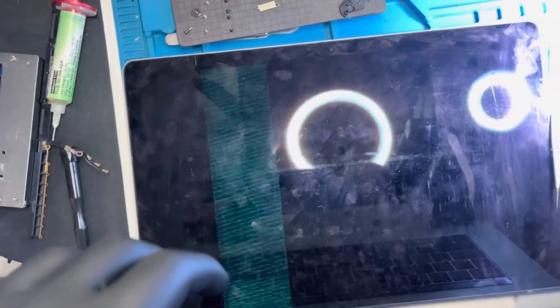Well, that sucks. We've got a working display other than this issue — and it's gone. The other issue with this design is how the cables actually wrap underneath the bezel of the display. Not only does that put tension on that weak cable that produces the 55 volt for the screen, you end up with debris building up over time — whether it's dust, tiny bits of rock, whatever — and eventually those bits collect and punch through, causing dents and damage to the data cables, which gives you those lines. Because they're in such a tight spot, it's really hard to fix. So I might give it a crack — we'll just have to see what the customer says and hopefully get the dub. Obviously it works once it's on, but it's a pretty good sign she's cooked. So a bit of a half-baked repair, but you get that in the big jobs. Catch you on the next one.